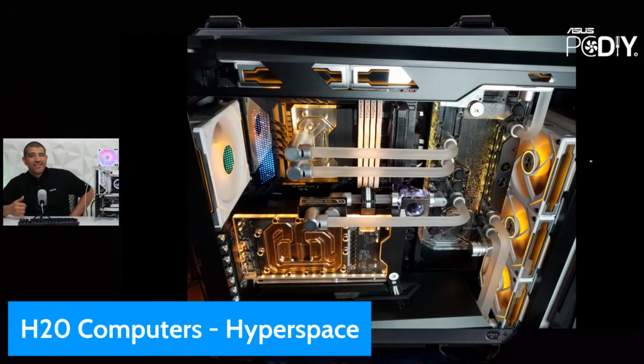And that's great because it's probably the best long-term reliable solution to go with in a lot of situations when you're water cooling. Also using CableMod custom cables in there, which of course look great, and we're big fans of CableMod. The ROG M.2 Hyper Card, Lian Li riser cable, and then frosted acrylic tubes, which are coming actually from Corsair, 14 millimeter. And then he's also got thermal pads in there from Thermalright and from Gelid as well for the thermal paste.